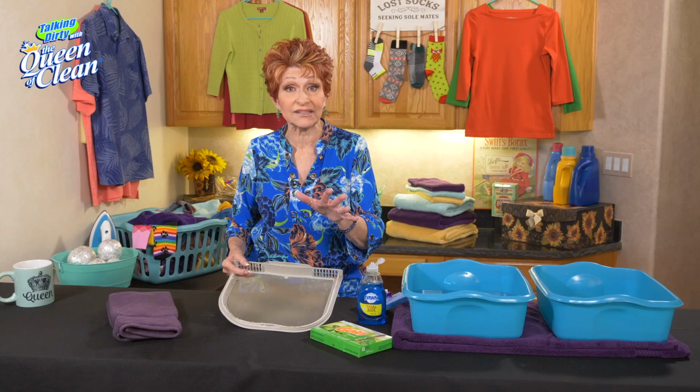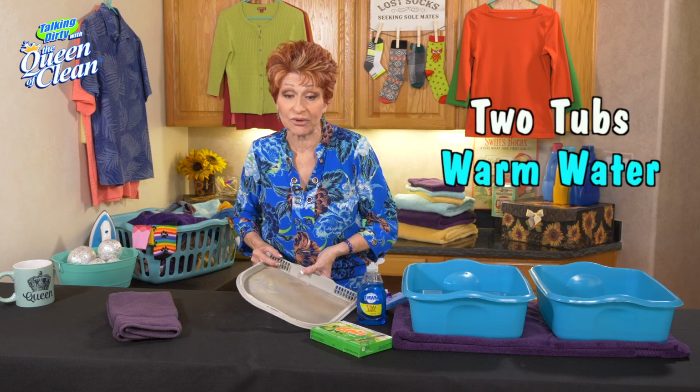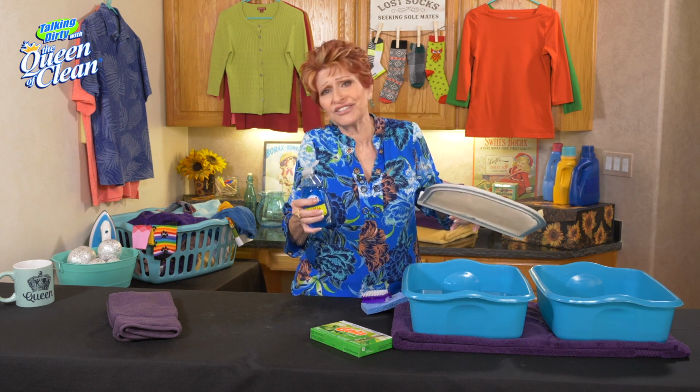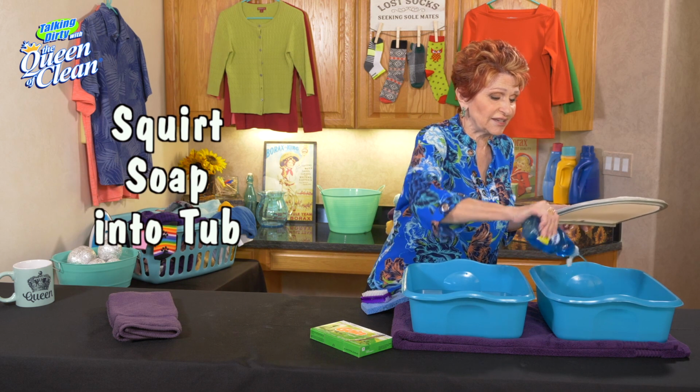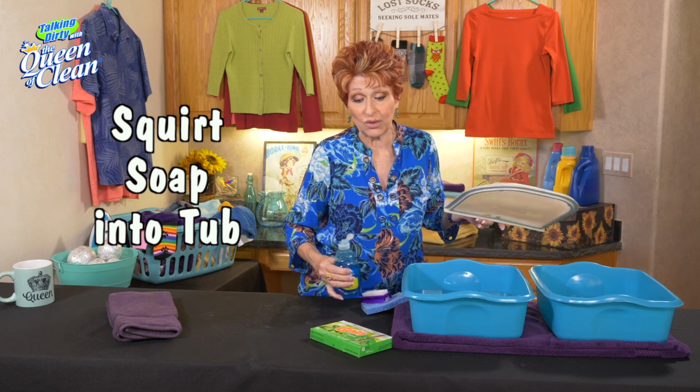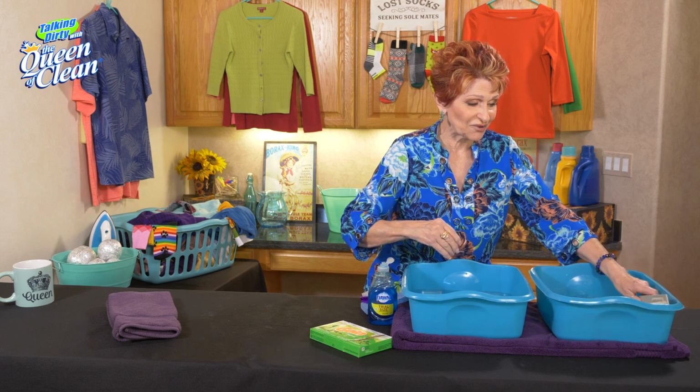I'm going to show you how easy it is. Now, I'm using a basin. You can use your sink or whatever's easy in your laundry room. So what we're going to do is we're going to take a squirt of any soap that you like, dish soap, laundry soap, whatever you want. And we're going to put a good squirt into some warm water. And we want it to be warm water. Then we're just going to drop that dryer filter down in there.